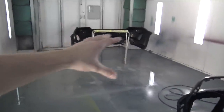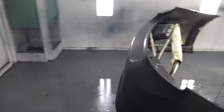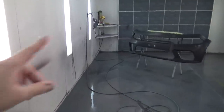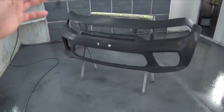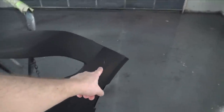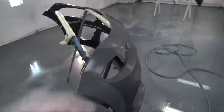I finally was able to get the bumpers ready to paint. The front bumper had quite a bit wrong with it, but the rear bumper was pretty much good, so I just scuffed it. On the front bumper I got rid of the license plate hole dimples — on new bumpers they just have dimples because they're not pre-drilled — and I don't run front license plates on any of my cars so I shaved those. I also found a scratch, fixed that, there was a nick right there, fixed that, and a cut right there I fixed as well. Now the front bumper is ready, the rear bumper is ready, and all I have left to paint is the door handles, the mirror caps, and the body of the car.